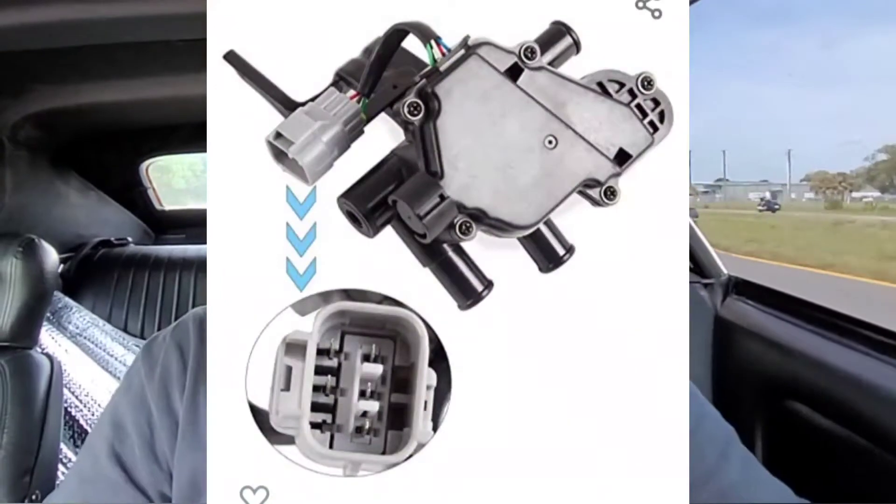What we're going to do today is change out a coolant flow valve, or coolant control valve. If you have seen an error code of P1121 on your Prius, that's what it's about. There are two things in there that are a bit confusing - there's one called a water inverter pump. The water inverter pump is a totally different thing from the control valve, as you'll see in the video. They're both really easy to change, and the argument could be made that maybe you change both at the same time, even if just one of the codes went off, but that's up to you.